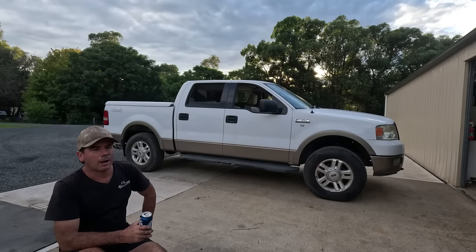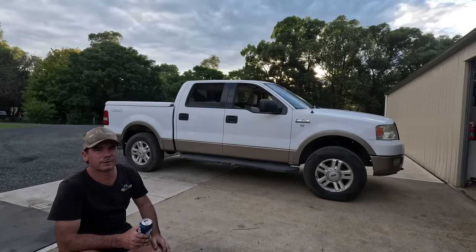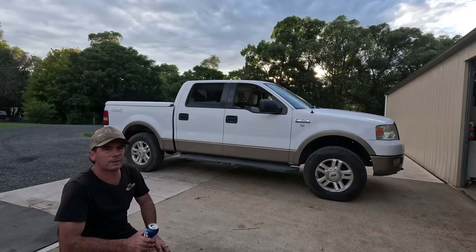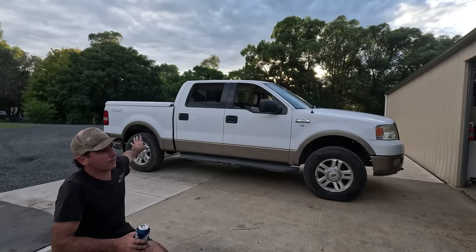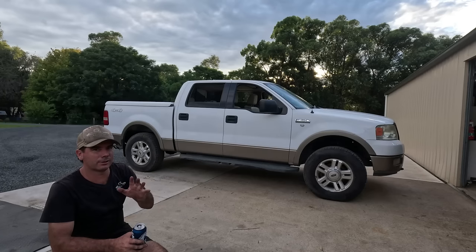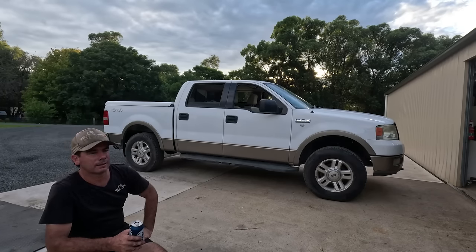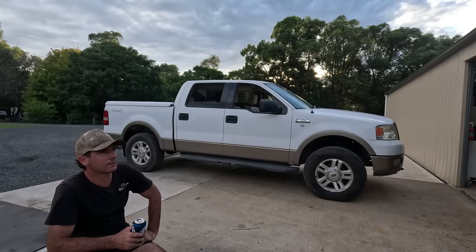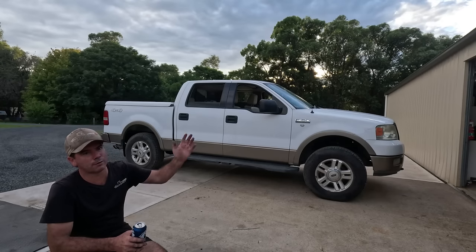Oh, I nearly forgot to tell you. The height difference. Of course, it's... How could you forget that? Well, I just did, all right? So it was 185 tire to the guard, 135 tire to the guard. It is now, and I shit you not, 185, 180. They are 5 mil different. So that's essentially given us, what's that, 45 mil. I said 40. 45 mil is what we got out of it. So from 135 to 180.